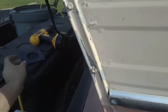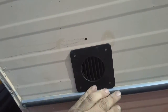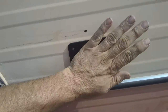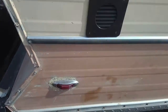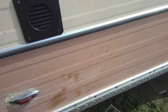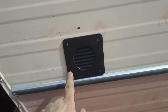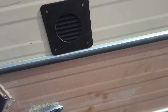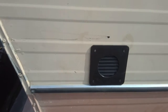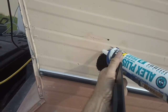I think that's it. The vent won't go like that — it'll go like this. Yeah, it's actually tight, which is exactly what I want. So now we get to go inside, cut a third one in the floor so air can come up from underneath to expel out the top. We've got to put some sealant and screw these down, and most importantly vacuum up the mess we're making, then actually connect these 6-volt batteries together and get them going.